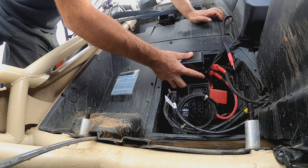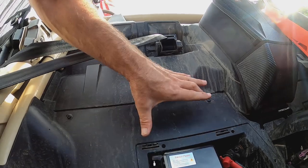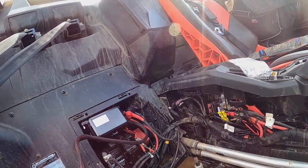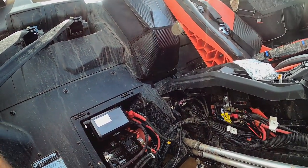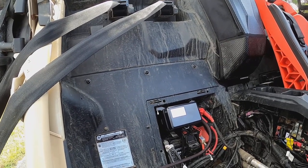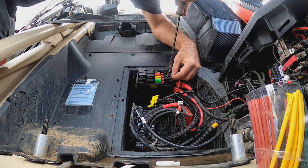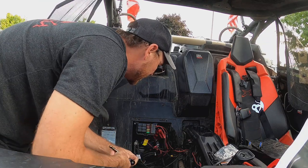So right there. Now I gotta figure out what hardware they want me to use. We blasted in two holes here and here, up through, so that's perfect. That'll sit back just enough. Bring my positives around here, and we should be good. So yeah, I'm digging this. This would be my positive to the power post here, so we'll leave it right off the post and wrap it up out of the way. Conveniently located, everything should look fairly stock. I'll be able to get in there and tighten that off from the backside. And we just drop her in like that, screw our post back down. And solid. Okay, I'm just hooking up the old positive here.